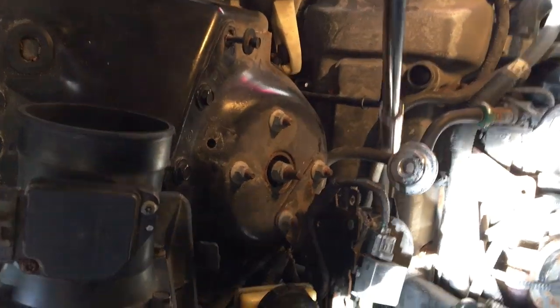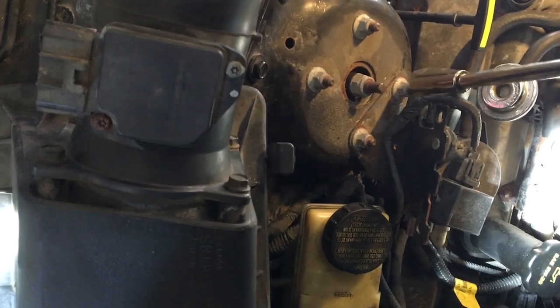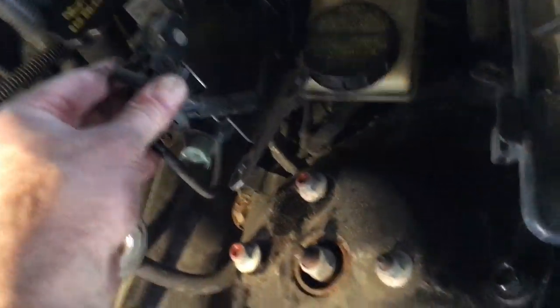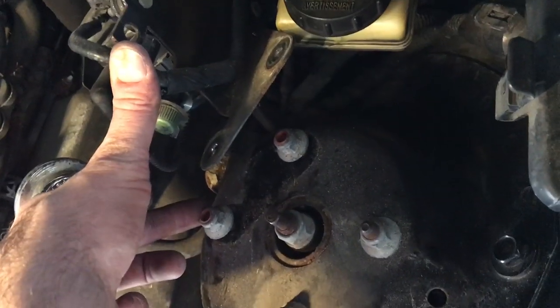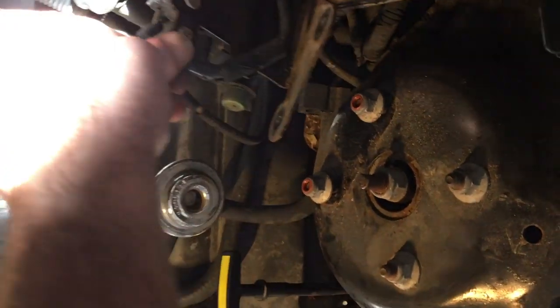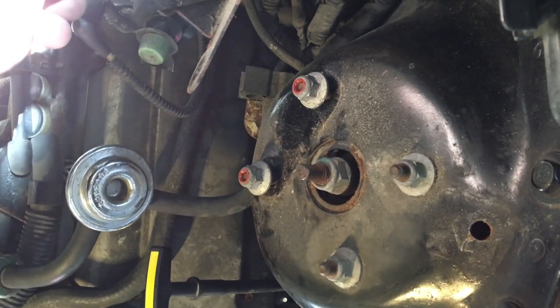On the driver's side, there's something in the way — a couple of bolts holding it to the shock tower. These are 13 millimeter bolts; I'm using a 13 millimeter with a nice long socket to keep out of the way. I'll remove these and move this thing out of the way. Once it's unbolted, I like to put the nuts back on the studs. Number one, label everything you take off; but also, putting the nuts back on keeps track of hardware and prevents you from nicking the threads when moving things around.